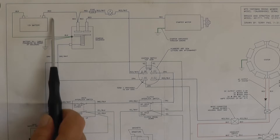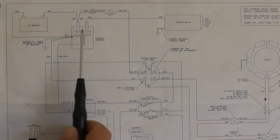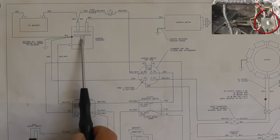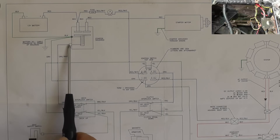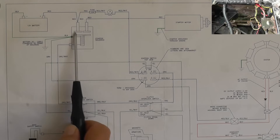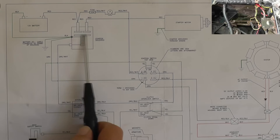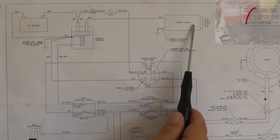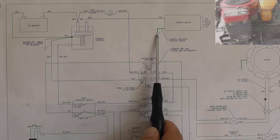Okay, let's do the easy part first. This line right here goes through the contacts and then comes out going over to the starter motor. So what do we need to get the current to come from the red post? It goes down to this fixed terminal. The plunger inside of the solenoid — basically when we put 12 volts here and here down to our ground, put a positive 12 volts there, and then this plunger is going to move. Then it's going to make a connection between these two fixed contacts. Current's going to come down, go through this contact, through the plunger contact. This contact is usually some kind of copper or brass type material so it can handle a lot of current for the starter. Then it's going to continue out on this red cable going out to the starter motor, and the starter motor is grounded through the mounting bolts, which is through the engine block.